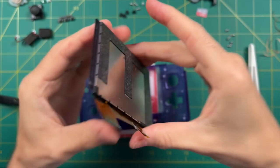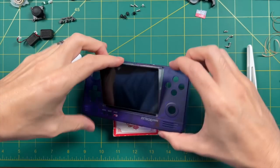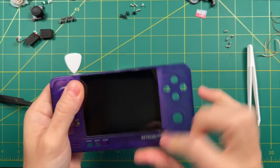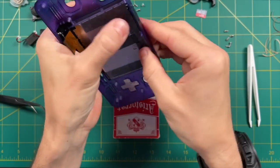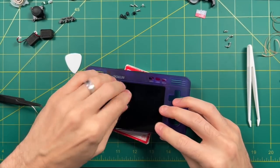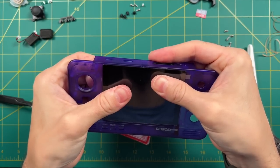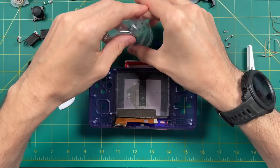Start at the bottom, make sure you snake through those ribbon cables, and then pull the ribbon cables until it's flush with the bottom of the case. Once you're good, pop it down and make sure it's all well aligned. From there, use your thumbs to push along the edges and back of the display. Normally when changing a display I'll put a stack of books on top and leave it for an hour, but because this has an adhesive backing across the entire back with multiple connection points, I don't think that's necessary. I personally think the Retroid Pocket 2 Plus has more tape than it actually needs.